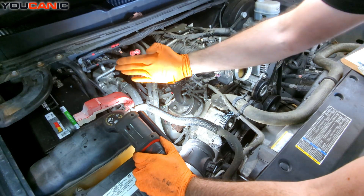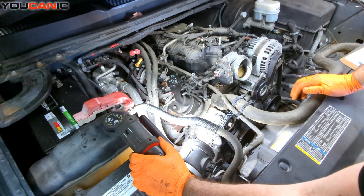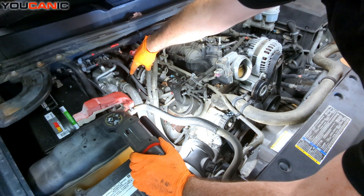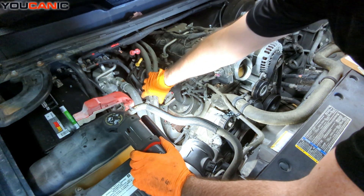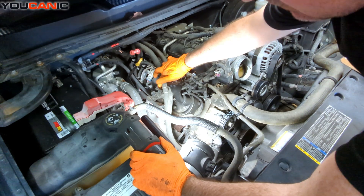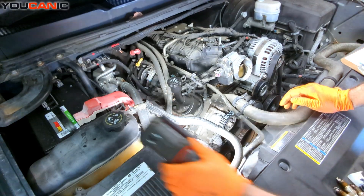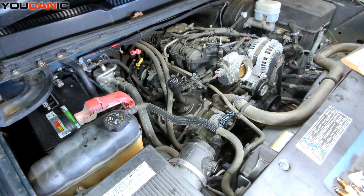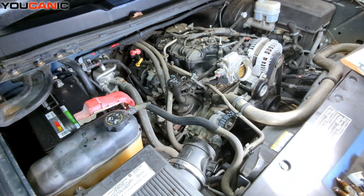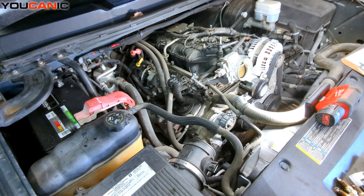These spark plugs go a little bit toward the back, whereas the other ones came angled more to the front, so that's what's a little bit different. The one in the very back corner may be a little tight to get into, but you should still be able to do it — you may need to move the heater core lines a little bit to gain access. You replace all four on this side the same way, replacing all eight spark plugs at the same time on this vehicle. That's how you'd replace your spark plugs on a 5.3 engine Chevy product. Thanks for watching — you can do it, where you can be the mechanic.